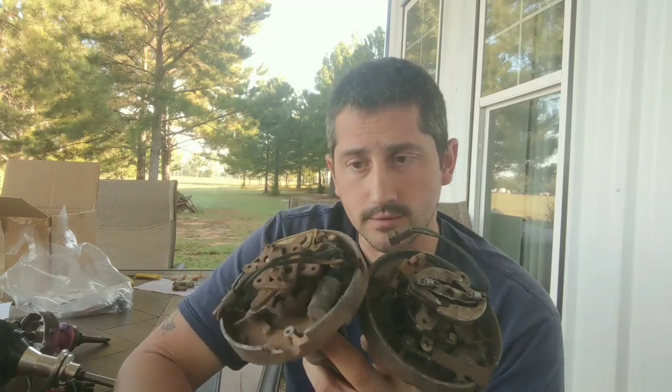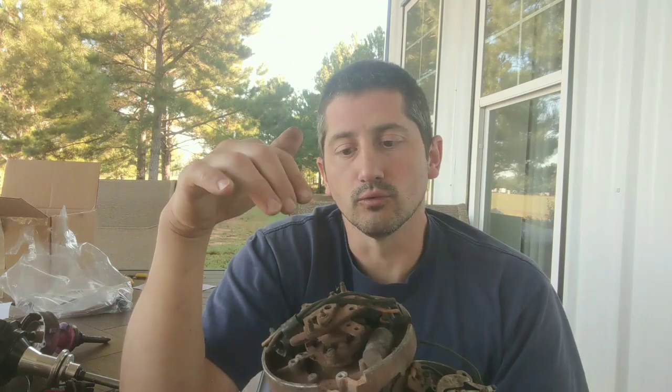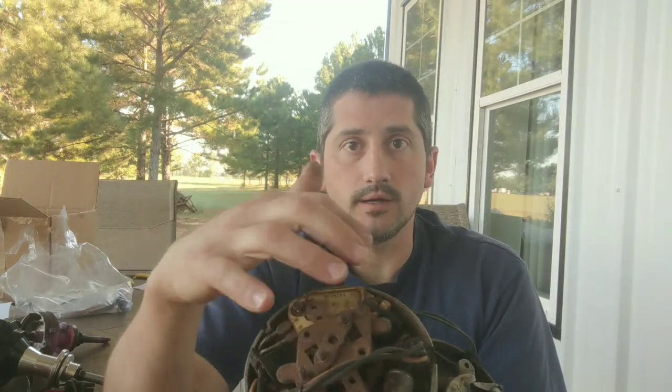But how do you run a DIS coil near plug or coil-on-plug system using old distributors? Well, I'm going to show you how. You take that pickup — there are two wires going to it. So you have eight tangs. There's basically your crank trigger right there. Your eight tangs.